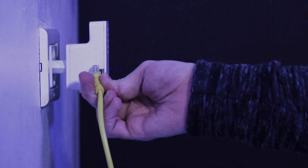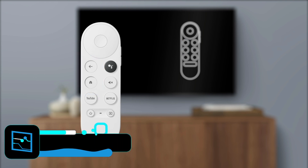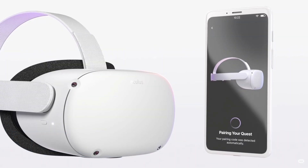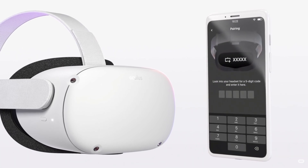Since this is all based on Wi-Fi connections, if your Wi-Fi router is quite far from your streaming setup, you might want to buy a wireless bridge so you can use that Wi-Fi hotspot to connect your Quest and the Chromecast. Now, set up your Chromecast and your Quest, and make sure both are connected to the same Wi-Fi hotspot or router — this is the only way they'll be able to cast to each other.